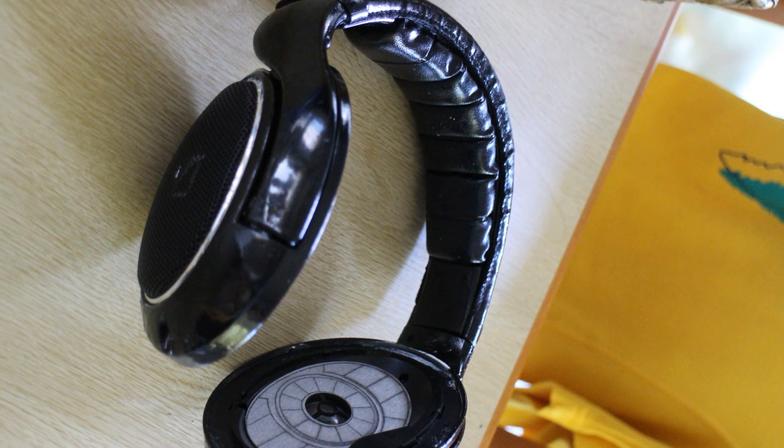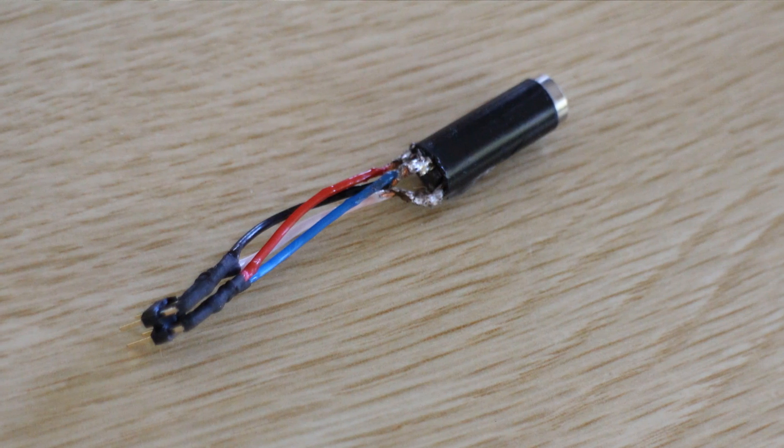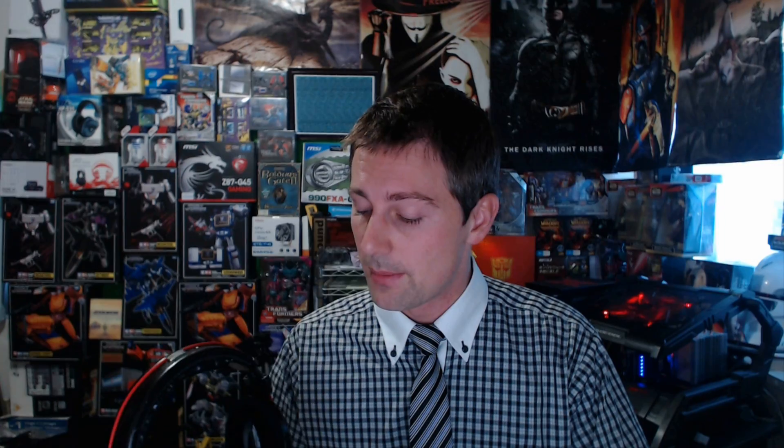Anyway, this is what I found — a pretty startling revelation. These are HD 595s. I was going to do the guide, almost had it done, and then the left and right speakers were swapped. Some guy had an incorrect wiring image up online. I looked on a Head-Fi forum and people identified the correct speaker wires, but when I got it right, the headphones just didn't work properly — the right was leaking into the left and it sounded crazy.